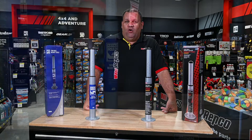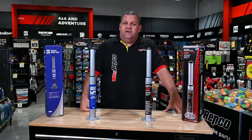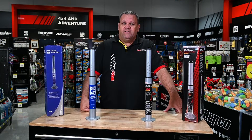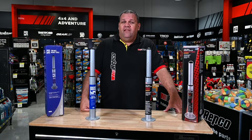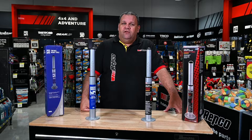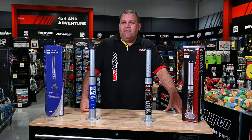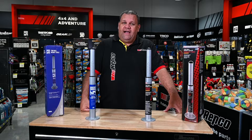How do we weigh it? We use a set of tow ball weight scales. You might think to yourself, why do I need to buy a set of tow ball weight scales? Well, the important thing to think of is that every single time you load your trailer differently, the tow ball weight may change. You need to ensure that tow ball weight change doesn't go above the legal maximum capacity of the tow bar or the car that it's fitted to.